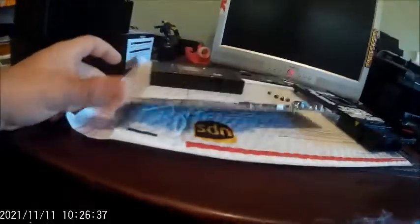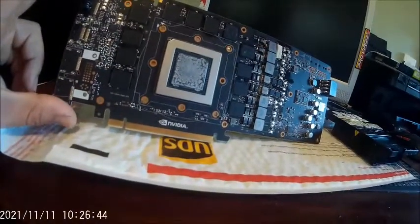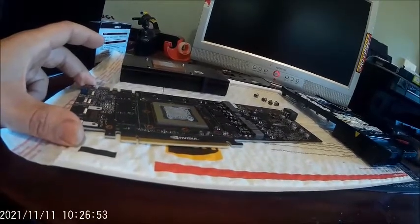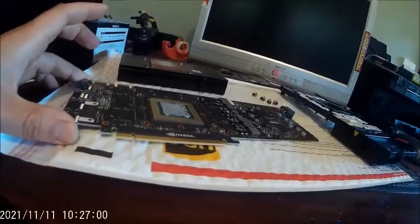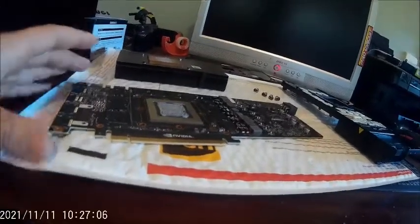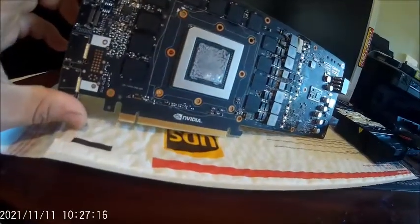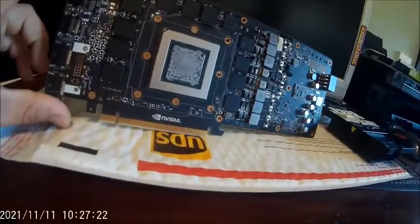To get these working on a gaming rig — you're probably saying it's pointless for gaming since it doesn't have any video outputs for your monitor. Yes, it's true, but you can do it in two ways. You can either have the video outputs basically tunnel through a secondary GPU, so this card will output the power of this card through a cheaper GPU. Or, if you've got integrated graphics, you can set it up so it tunnels through the integrated graphics port on your motherboard. And then you'll have all 24 gigs of VRAM, the power of a GTX Titan, for the price of a Tesla M40.